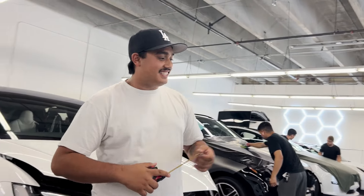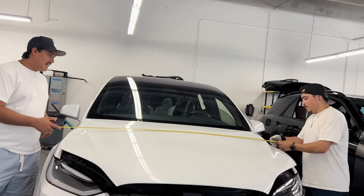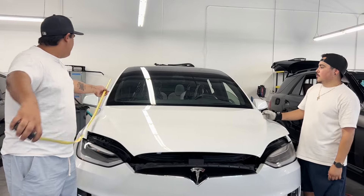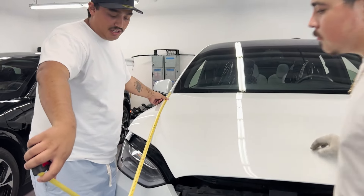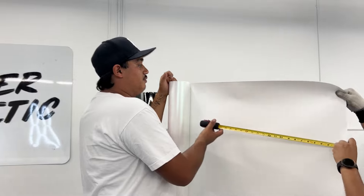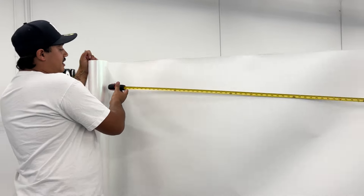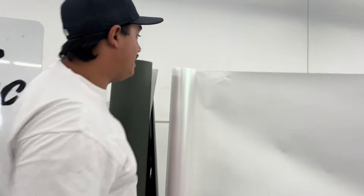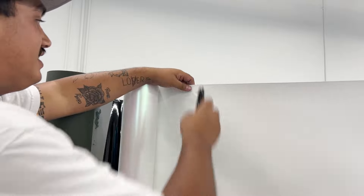What's up guys, Justin from Driver Aesthetic here. We're going to be wrapping in some Aura vinyl today, and I'm going to show you how to measure and cut properly so you don't come up short and you have enough vinyl to wrap your whole vehicle. Grab a tape measure and a friend to help you measure, give it a couple of inches on each side. I'm six foot across by just under five feet, so we're going to cut the vinyl six feet long and roll it out to that exact length. I nick it with my finger to mark where to cut, then use my snappy or whatever blade you have.